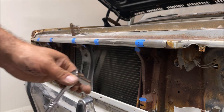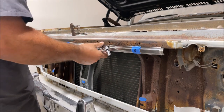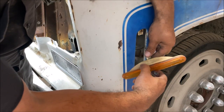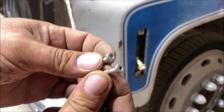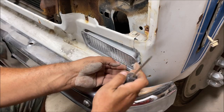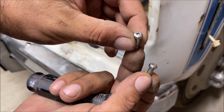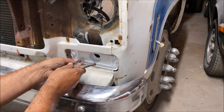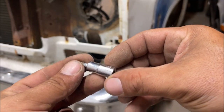On the top you can get a quarter inch ratchet on. We're going to be replacing these two — let's check out the screws. All of these should be original. We have a clear 194 bulb. These are one inch long T15 with a little thicker head. For the parking light and signal light these are just over three quarters of an inch. I took these out and painted them. These are 9/32nds — this is an '80 so this could be metric; seven millimeter works too.